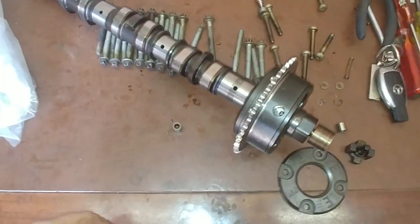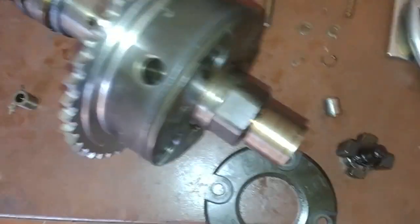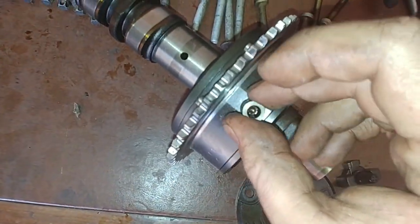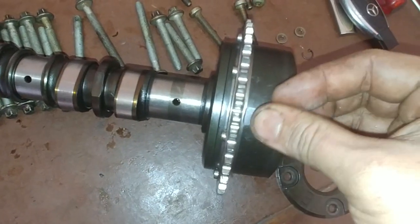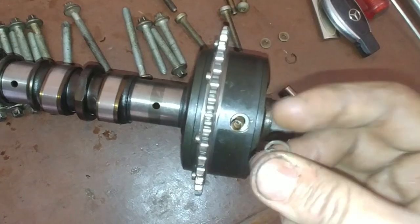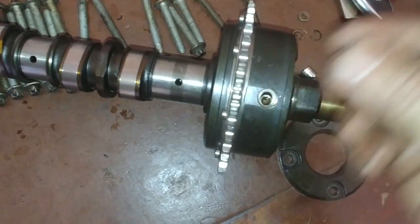That piece has now been connected — front's on there, I haven't tightened it yet, and the back's on there with the springs still inside. I take the intake piece, slide it in there. That one gets a little spring which pushes it down all the way. The circlip on this one is a bit busted up so I have to go get another circlip. Then this one gets another plate on top, and the circlip holds that in place. That basically covers you for the intake.